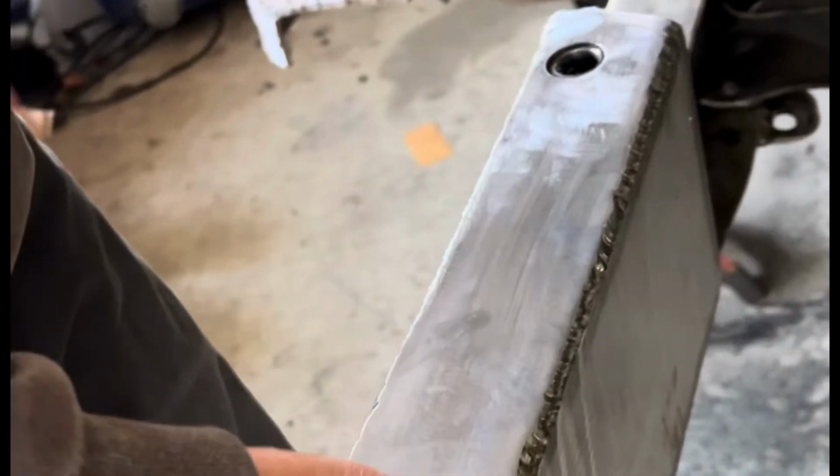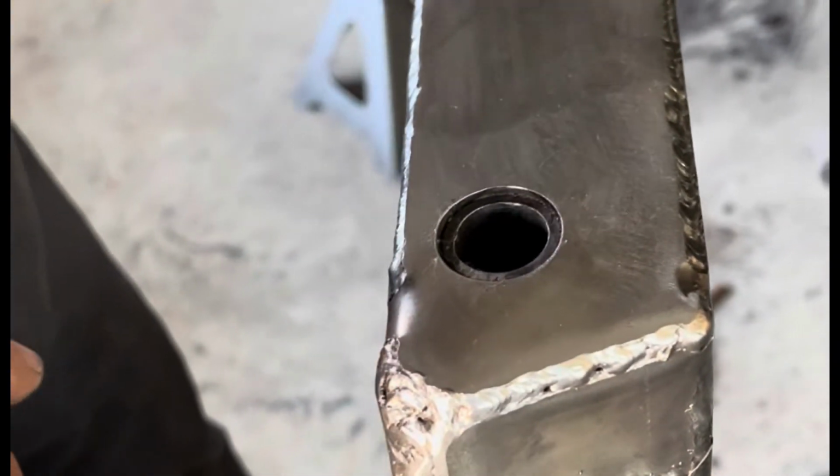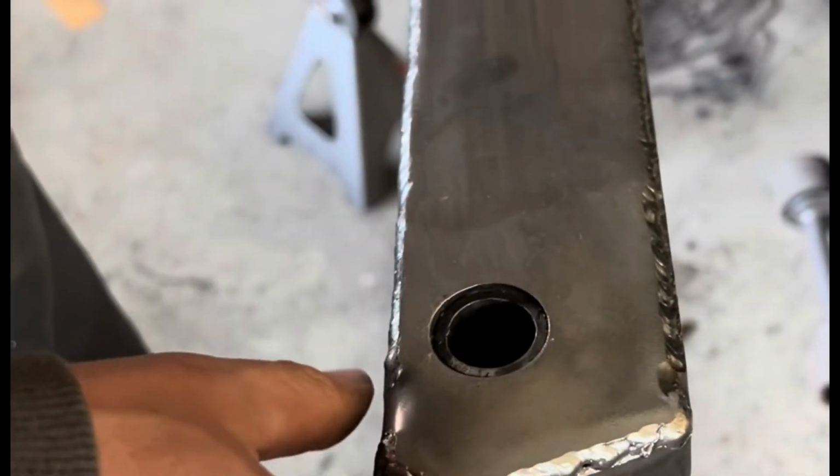Here's what I had to do to the frame. I got the cheap, I think it was like a $60 kit. I don't remember who makes it, but you have to cut the frame here and then slip it down in and weld it. When we did that, the frame was bent right here. So we had to cut the frame and make it straight and then weld a piece in here